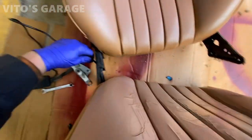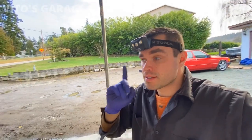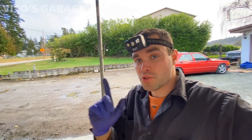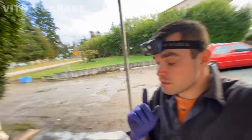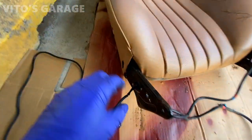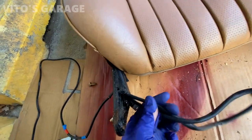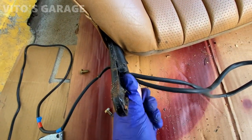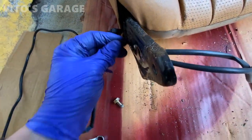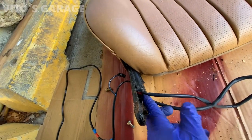Pull this all the way out. One of the reasons I love old school Mercedes is that anything you do doesn't take much effort — yes it takes effort, but it's not crazy. With a newer car you would not be able to do this. Here's your seat belt buckle — it's got two connectors, black and red. You can see how this hole is enlarged and there are all these other wires going to the headrest motors. With this old Mercedes you can just move these wires out of the way — one connector — take this bracket off, and here's the other connector.